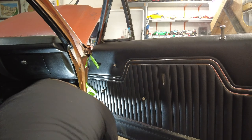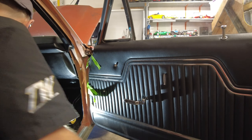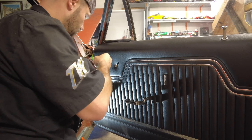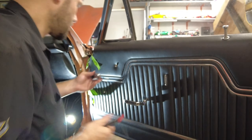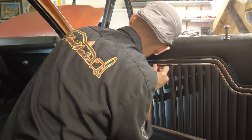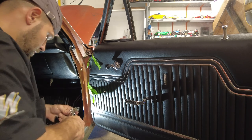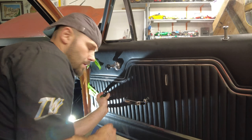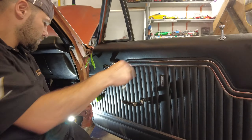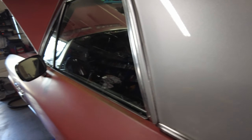While that panel's drying, I'm going to go ahead and install the armrest, the window cranks, and the door opener lever, and wrap up this interior door card installation on this El Camino. The knobs and levers are held on with a body clip — be careful not to clip the upholstery when you push the clips on, the edges can be sharp. Take your time and pop these clips in and out using a pick tool. Lastly, I took some interior finishing screws that have a captive conical washer on them, located the pre-drilled holes from the original door card along the bottom of the door frame, and put those screws in along the bottom of the door card.